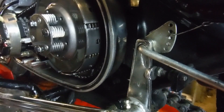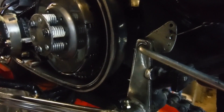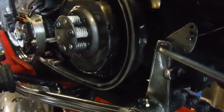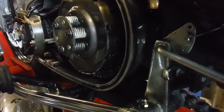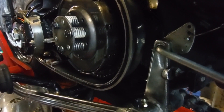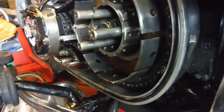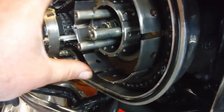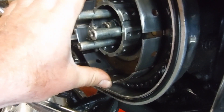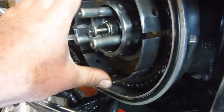I've got to get the pressure plate to lift evenly, which I've done on others in the past, and I'm pretty confident I'll get the same result here after a little bit of work. We'll come back to this when I may have found or fixed the cause. Here we can see I've got the bullet clutch dismantled now, and I'm hoping to demonstrate with the machine still in gear that there's no throw or wobble on the clutch centre or the clutch basket.